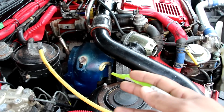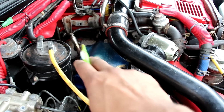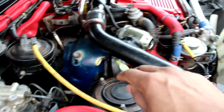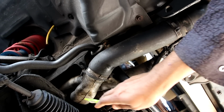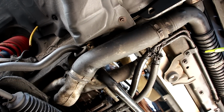Now the turbocharger on this car is a standard CT26 turbocharger, and it's right out in the open here. It's driven off of the exhaust manifold, and that's just going to boost the pressure of the air that's flowing intake here before going back down into the air intercooler. Now that boosted air coming off the turbo is going to come down into this charged air pipe underneath the vehicle here and then travel over to this air intercooler.